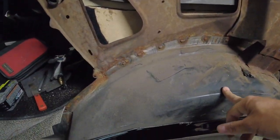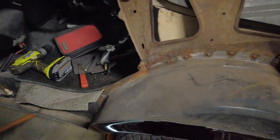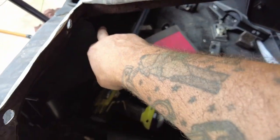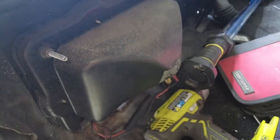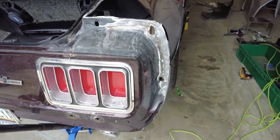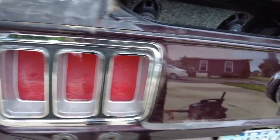This car looks like it's also had a wheel tub. The work looks okay — everything's in the right spot as far as I can tell. But a lot of it's unpainted and unfinished; I think they just put this car together to get it on the road. I'm going to start working on getting this piece of the quarter panel removed. Under here there's some garbage. I'm going to probably end up replacing this piece — it's not the taillight panel, but there's a piece that goes from in here around this way. I'm going to go ahead and replace that too, just because I don't like how they did this. It's not correct. This big gap here does not exist on the other side, which is as it should be. So I'm going to make this right.